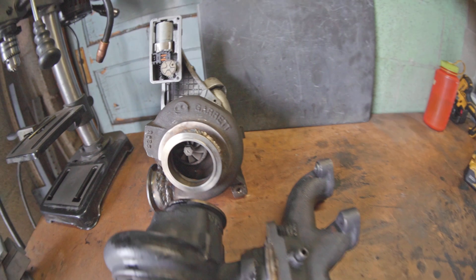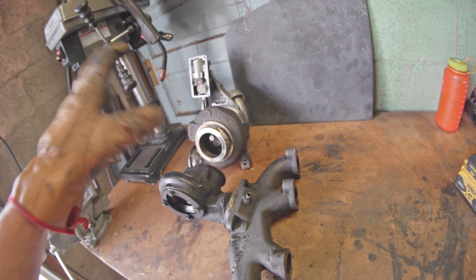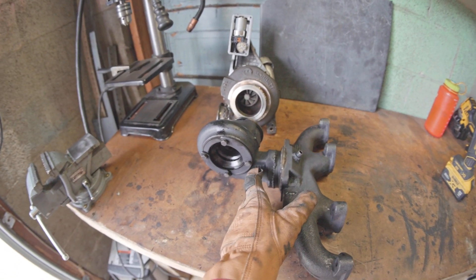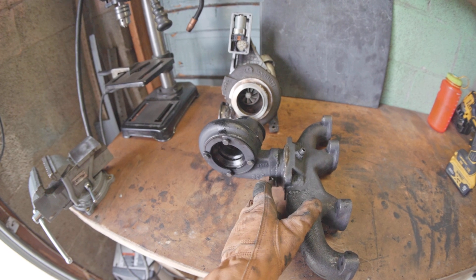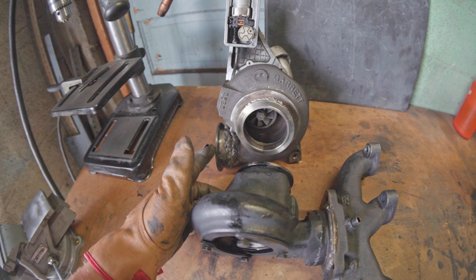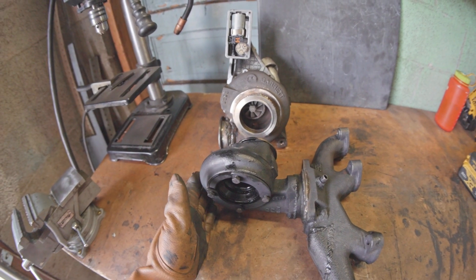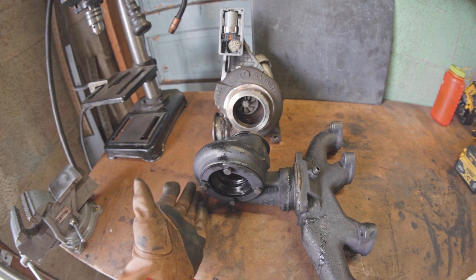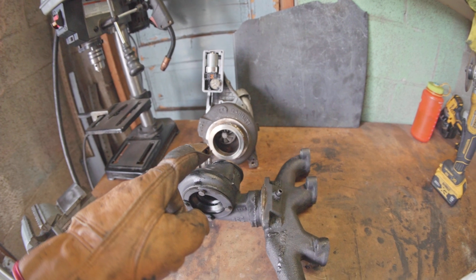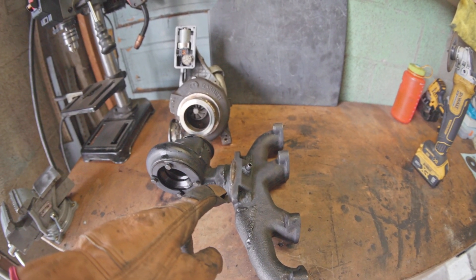Just showing some size comparison — this new one's quite a bit bigger. Fingers crossed it actually spools. I think we have a good chance because of the vanes. Looking at width here, I think this turbo — the 20 here in front — had quite a long run into it on the turbo itself, whereas this one's pretty snug, so I'm hoping maybe it just works, maybe it just fits. We'll find out. I'm going to cut this off and re-bolt this to the car, then dry-check that on it, and then decide what I'm going to do for an attachment.